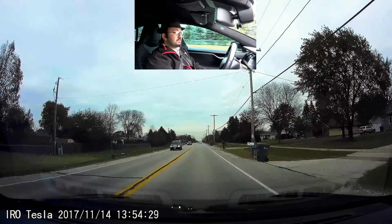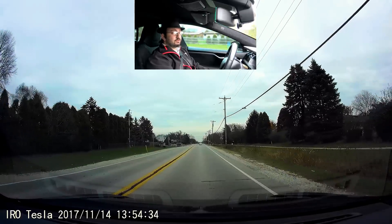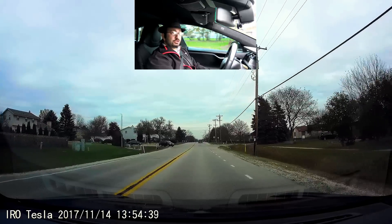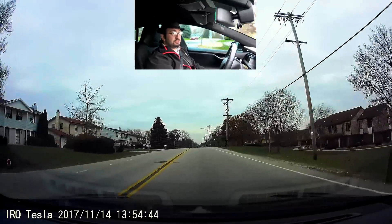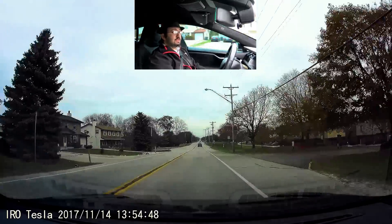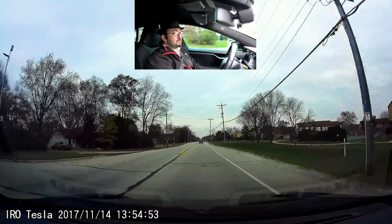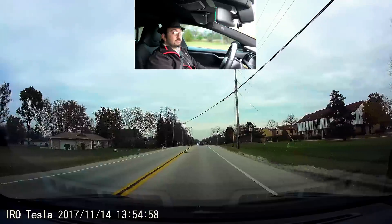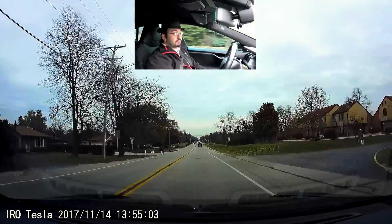That's Tesla's hard-coded cutoff limit — below that, they don't want the vehicle to skip heating the battery pack. Now, if the vehicle is parked, not charging, and just parked, that heater — and this is a common misconception — is not going to turn on unless the battery pack gets to the danger levels that Tesla has hard-coded. If you're not plugged in, that battery pack heater will draw power from the actual traction pack. And if you are plugged in but not charging, it will draw that power from the wall or the grid.